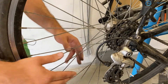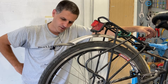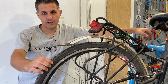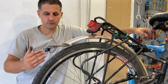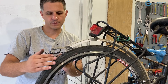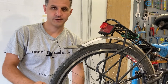No spokes are out of true. What could cause the wheel to go out of true if no spokes are loose or too tight after a tube has been replaced? The first thing that pops to mind is to see if some spokes can be tightened. But problems with the tire — if it's not seated properly or if the sidewalls are damaged — can also cause the wheel to come out of true, because the pressure of the tube isn't pushing equally on each side. A cracked sidewall could cause uneven tension on the rim.